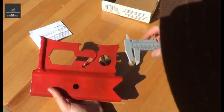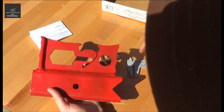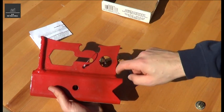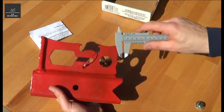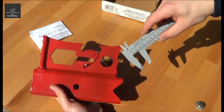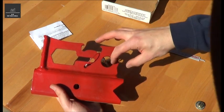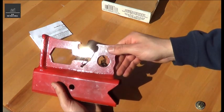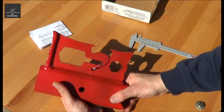According to Australian standards, that 25mm hole should be about 1.5 times the hole diameter as the minimum edge distance from the edge here. This measures at most about 14mm. So really that should be a bit thicker for Australian standards, but no doubt that it will definitely do the job.